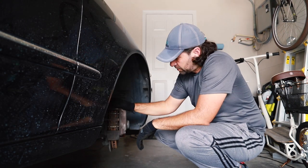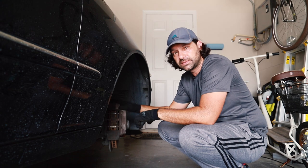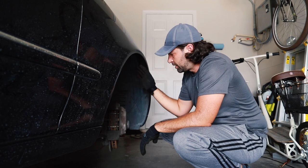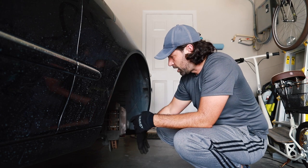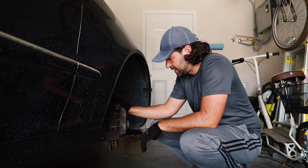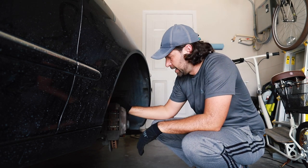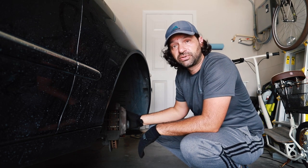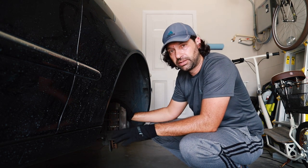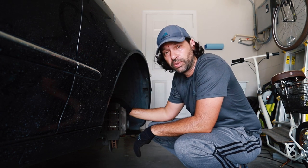These are what look like four-piston brakes, which are standard on the S500 base model. If you get the S55 you probably have the Brembo, which I believe has six pistons. There's enough meat left on these rotors so there shouldn't be a problem with the pads or the rotors. However, when I step on the brake I get this little wobble. I called about 25, maybe 30 places locally and nobody wants to turn cross-drilled rotors.